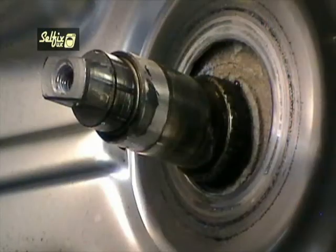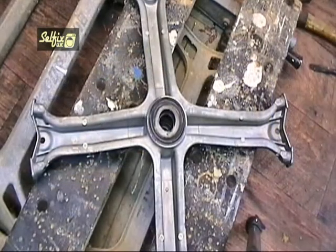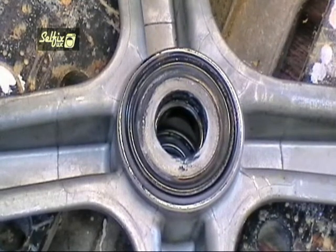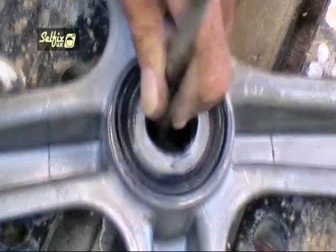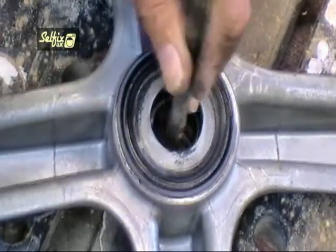Check the drum support shaft for signs of corrosion or rust. Lay the frame on something off the ground so you can knock the bearings out. Use a rod or cold chisel and knock them out by varying the striking point. This way they will come out evenly and not damage the housing. The inner bearing and seal come out as one unit but they are fitted separately.